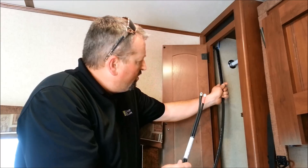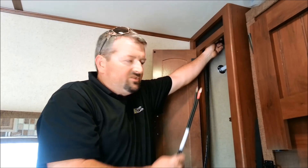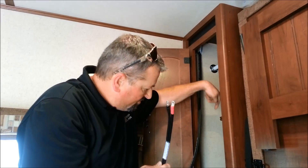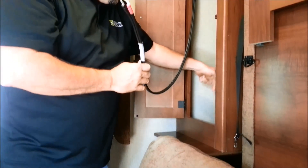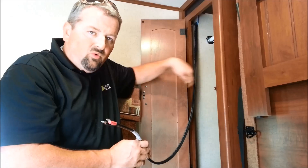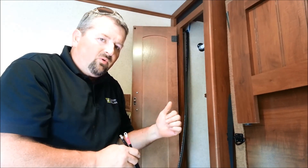I've already started pulling this wire and have it tucked behind this wall. I'm going to drill a hole through the ceiling so I can put this through and connect it to my three-port roof cap up on the roof. Then I'm going to run it to the controller down inside a cabinet or outside storage compartment next to my inverter. You can flush mount or top mount the control panel to the wall wherever you prefer.